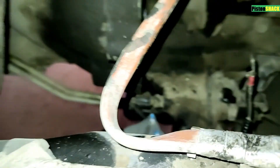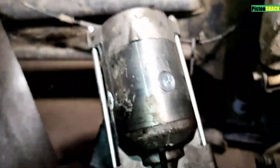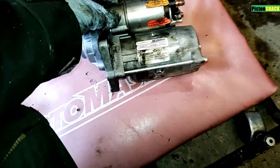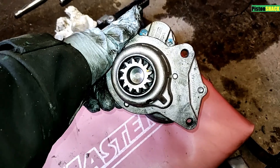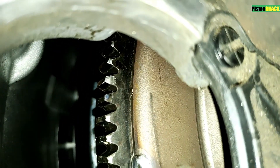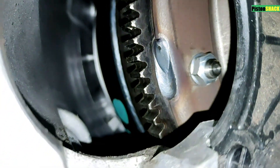Okay, the starter is out. Now we're almost ready for installation — but this is a removal video only. As you can see, there are three holes where the bolts were, and that bottom one was threaded. Check the condition of the flywheel — good time to check the teeth. This one is acceptable, a little bit chewed up.